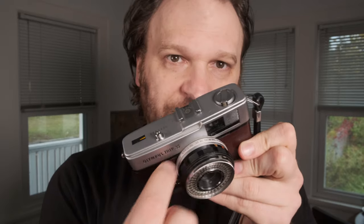Not guaranteed that this works with every copy of this camera. If some mechanics inside are a little worn out or some springs are worn, it might fail. I have seen it where sometimes when it's set to the 1/200th aperture mode, bumping the camera or even changing the aperture will cause the ping and the shutter button to have that play again. So you kind of have to learn how it feels and make sure it's actually going to happen — but it's pretty obvious when it doesn't engage.